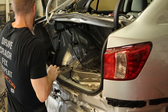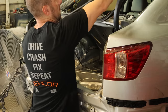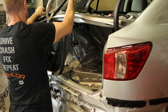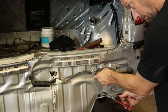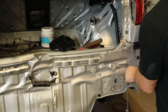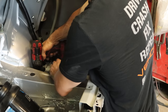We're going to pull this trunk gasket off. Scott's Lexus Emporium doesn't have an extra, so I don't want to destroy it. I'll throw it in the pile of stuff to go back on the car and deal with all the gooey fun stuff that Toyota puts on there. We'll pull our wiring harness off for the antenna, unplug it, push the grommet out, and stuff it back through the body panel. That's the antenna for the keyless entry, in case you're wondering what kind of antenna they'd hide under the bumper.